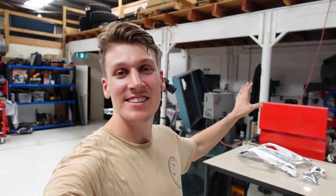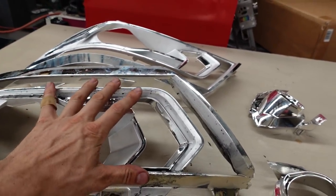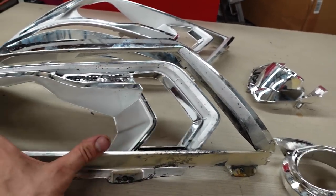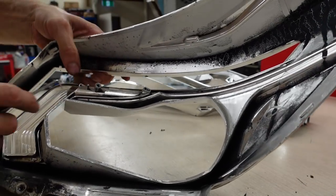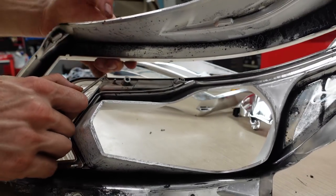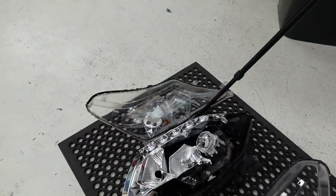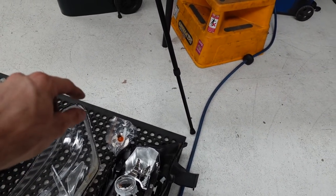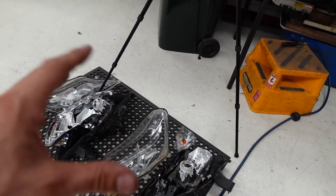The lights are now completely disassembled and all the parts I want to paint are laid out. From each light it's two pieces. I've pulled the plastic pieces out of the surround — the top one came out pretty easily after removing the screws, but the outer two are a little bit tricky because they have plastic clips that can break real easy. I used a pick tool to pry the plastic clips out. I've also got all the headlight parts organized by corresponding side — left and right — and all screws in a ziplock bag to keep them together, because everything looks relatively similar and could be confusing when reassembling.